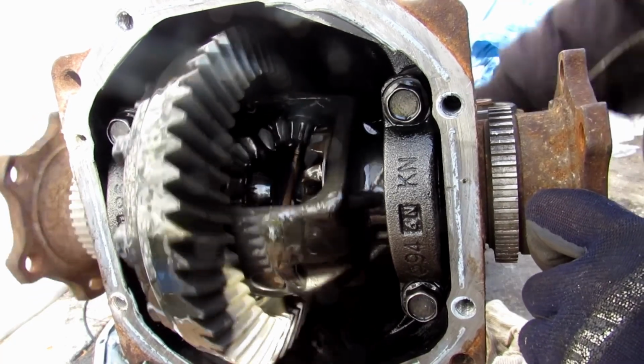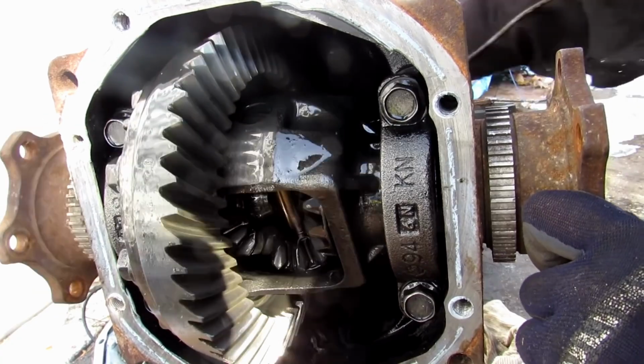If you get this done and you're unsure exactly where it's at, you can always line your marks up and try again. The reason you have to turn your tire twice with an open diff, or multiply it by 2 if you only turn it once like how I did it, has to do with the way the spider gears and the differential work. With one tire planted on the ground, the spider gears have to rotate since one axle isn't moving, and it kind of doubles or halves the rotation of the other side depending on how you look at it.